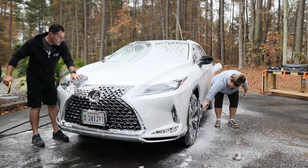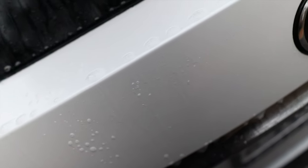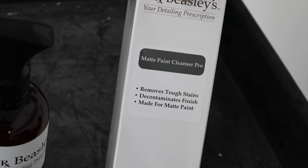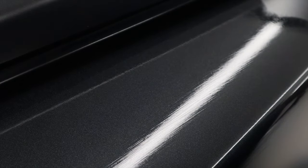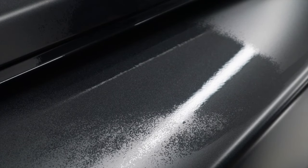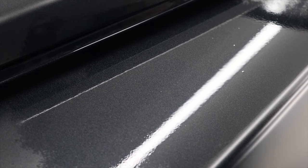Whatever your process, we typically decon after contact wash and clay bar, then use decon — either order works; you just have to figure out your standard operating procedure. If necessary, we have the Matte Paint Cleanser Pro — the sledgehammer. When you've upped your chemical aggression multiple times and aren't making progress, this solvent-based cleanser is the answer. It's so aggressive we can only sell it in a four-ounce bottle. It's still paint-safe — anything beyond this is mineral spirits or thinner — but this is absolutely the last resort.